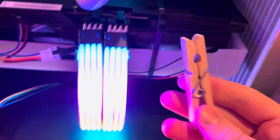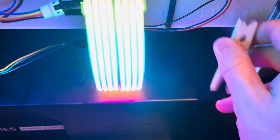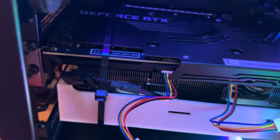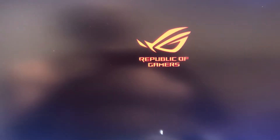The solution for the time being — I found out that this clothesline clip thing, if I just stick it right here, it's like the perfect size to hold this graphics card up. So then if we reboot this again, it should boot right up and get past the white VGA light of death. It's green — and there you go, boom, it boots.